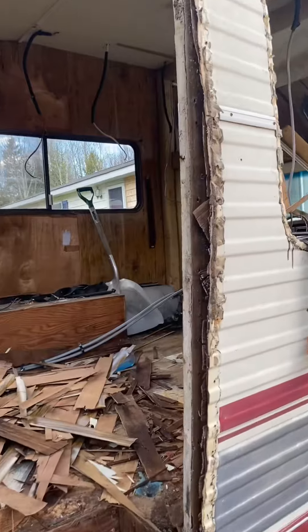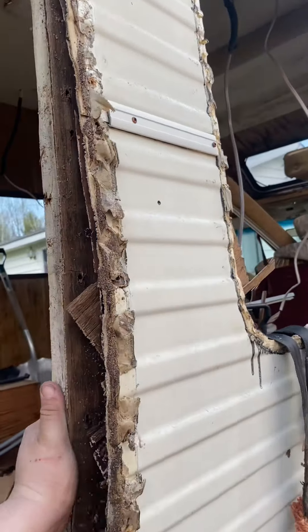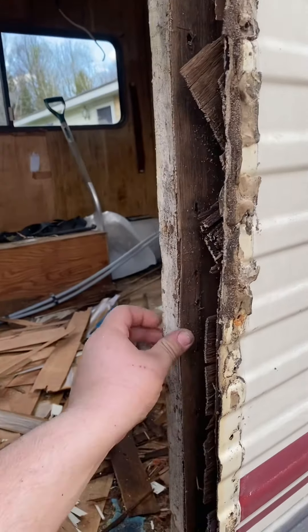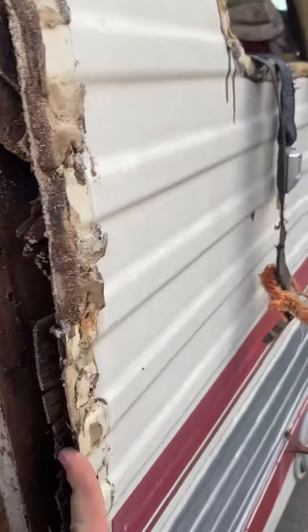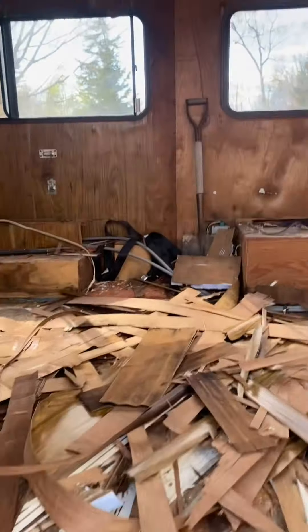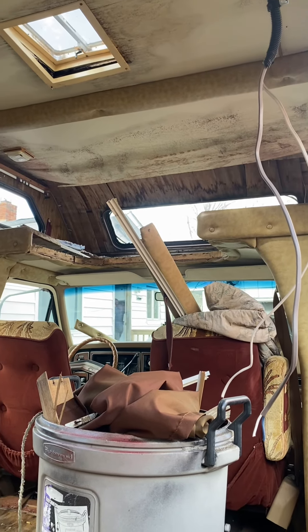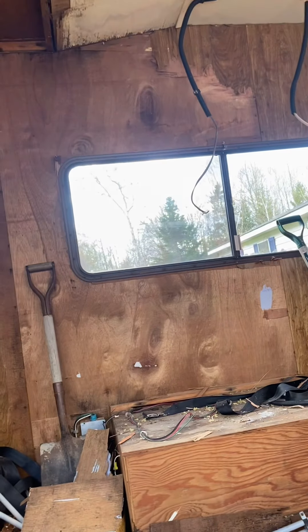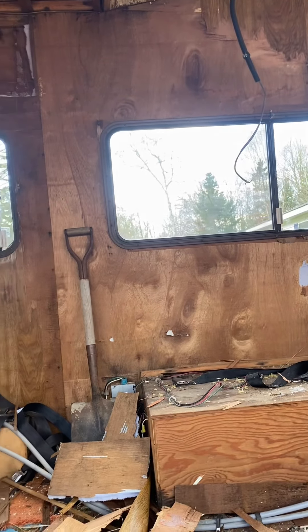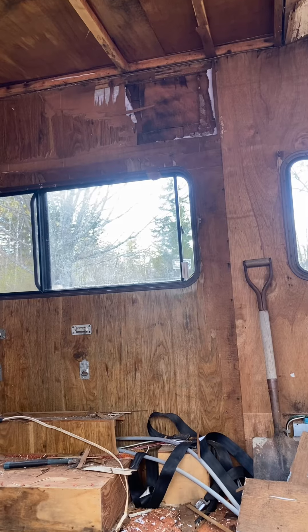More has been done. I think I've decided to try and reframe and restructure and continue the rebuild. So that means things like that are getting replaced. I bought some epoxy - I'm going to try and re-adhere the wall in spots where it's delaminated. Inside, started tearing apart up there. Found even more major rot. Pulled the carpet out - more rot. That wall's not bad, but it did delaminate, so we're going to pull the paneling off and replace what needs to be replaced. More delamination - more rot there, so I'm just going to pull that off and replace.